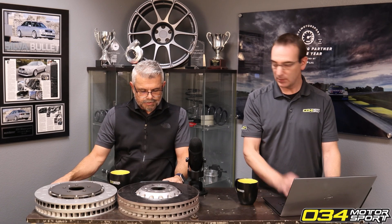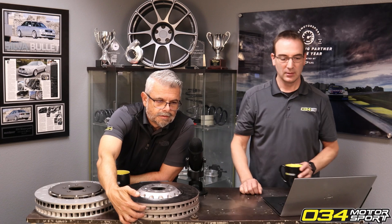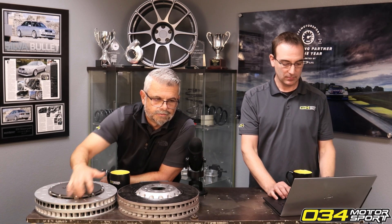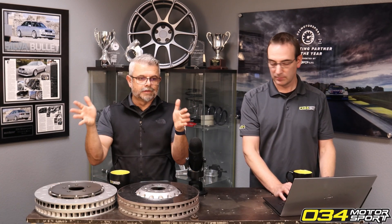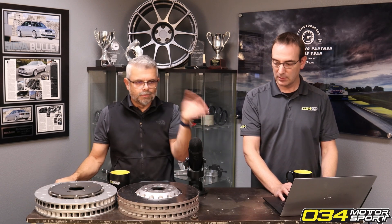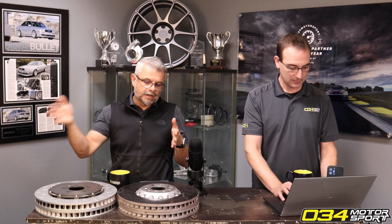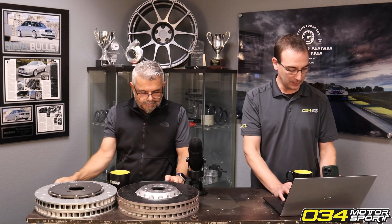You can see the vane differences here. These are the OEM rotors — you can see the vanes are both going the same way. On our rotors they're going the opposite direction, so you can visually see the difference. That's the fact that we have left and right rotors. The factory uses two lefts — the left side is correct, but the right side is actually a left side, so the air on the right side is getting sucked from the outside to the inside of the hub, which is not the way it should be going.